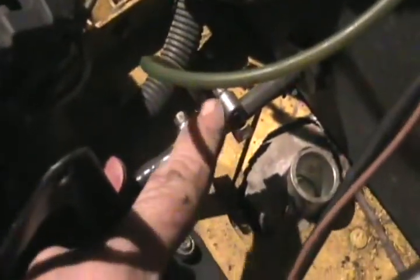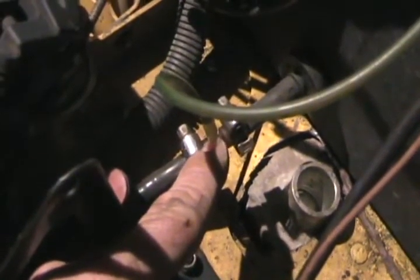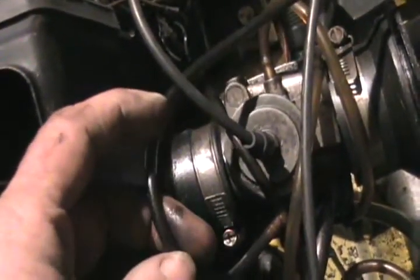So use little clamps. Sometimes I even wrap some mechanic's wire around these little tiny spots, since there's no clamp small enough, and pull that tight. Make sure there's no cracks in the hose, because that certainly happens by itself when the pipes dry out.